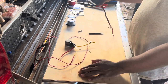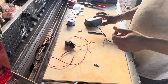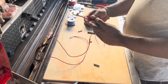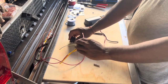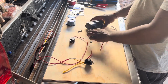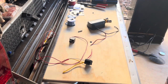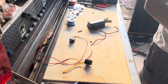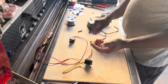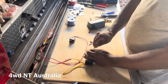So whatever is connecting to the connection kit I'm doing now, just building up — it's like a normal wiring harness you'd buy for a roof light or spotties. This red wire is going to your connection kit, so red to red with the butt connector. I don't have red heat shrink today so I'm using black, and I'll put red tape over it later. You can solder it too, but for heavy duty stuff I normally prefer a nice butt connector for a strong connection.